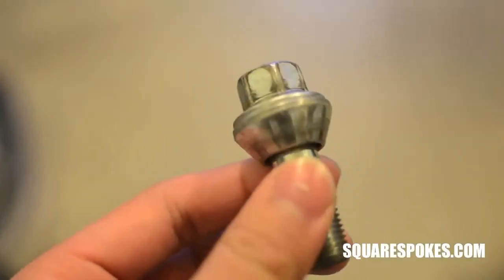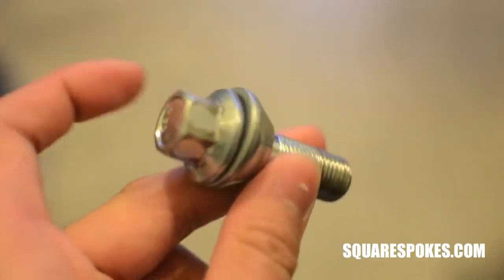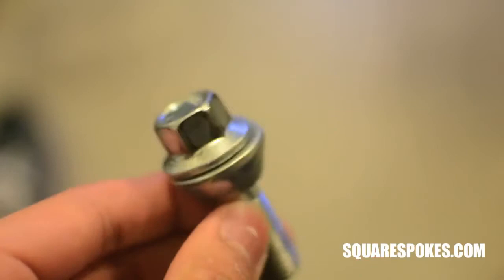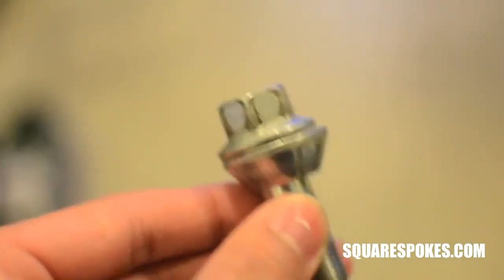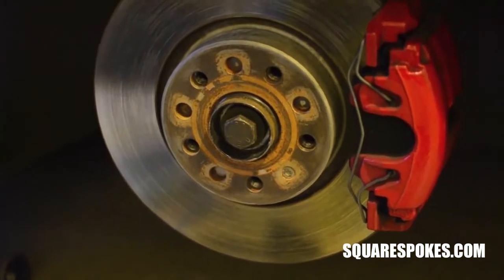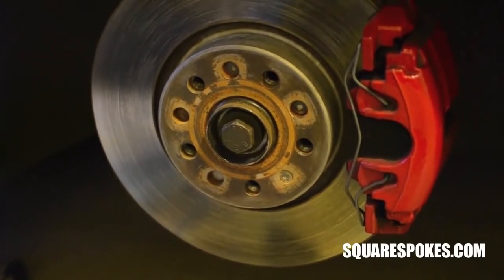Some of the main advantages to wobble bolts is that they don't add weight, nor do they change the final offset of your wheels. They're basically just bolts. Another thing is they're relatively inexpensive compared to some of the other options we talked about earlier. I'll include some links of where you can get wobble bolts in the description below, so check it out. One of the biggest disadvantages with running wobble bolts is that it only allows for a small range of variation. This really does limit you to the application and what wheels you plan to run.